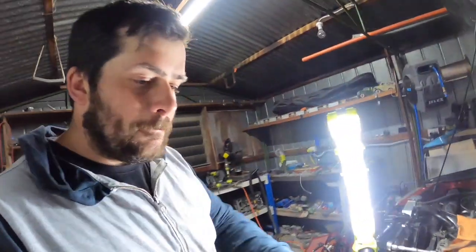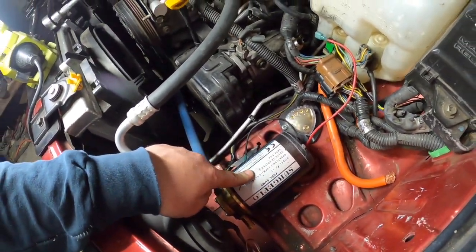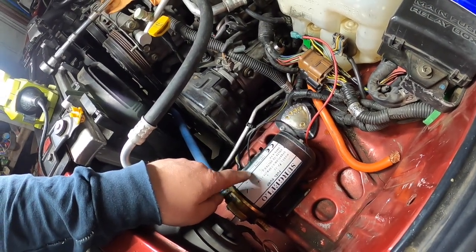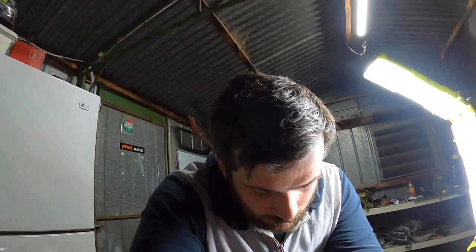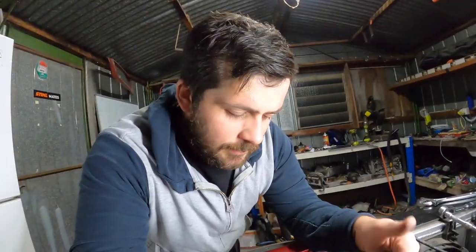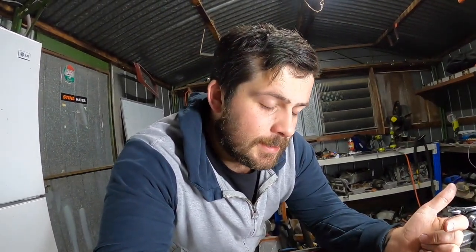Bought a relay as well because it only pulls six amps. Anyway, we're going to put a relay in there. Eventually I want it on a turbo timer or something similar, so it'll run for like another five seconds after it turns off. I can get a pretty basic one from Jaycar and then I'll be running two turbo timers.